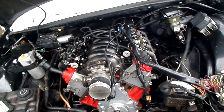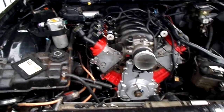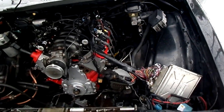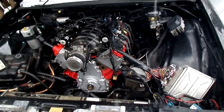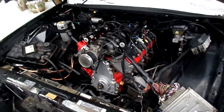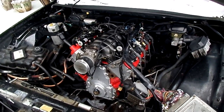The engine fits right in. The passenger-side LT1 bracket is about 2 or 3 inches pushed back to account for the AC compressor, so you've got to account for that. I'm going to try to use the factory truck manifold — cut it and clock it so I can use the factory exhaust because I want the car quiet. All together, to have a driving car it was about $800, including the engine, the rebuild kit, the truck tuning, and miscellaneous parts. So yeah, it's in and running.